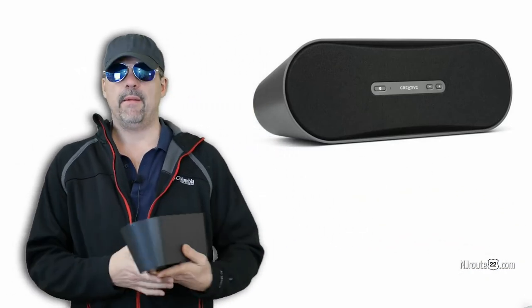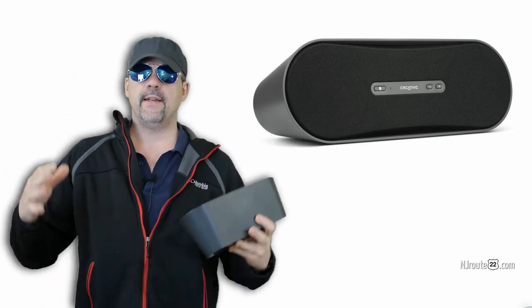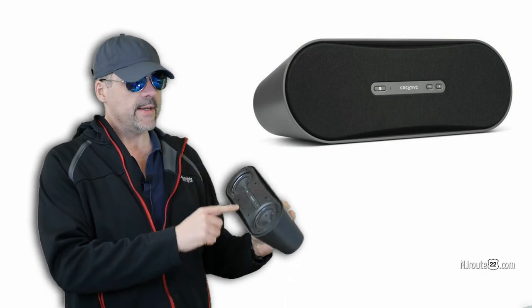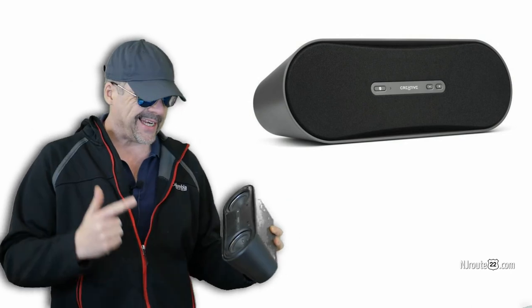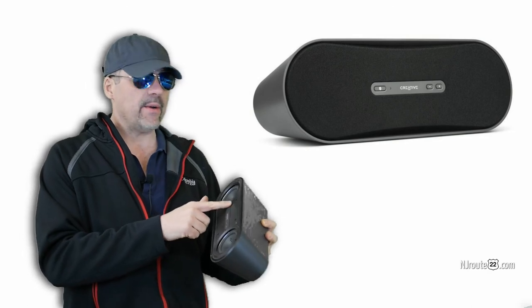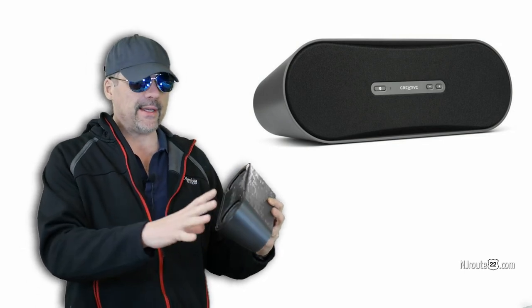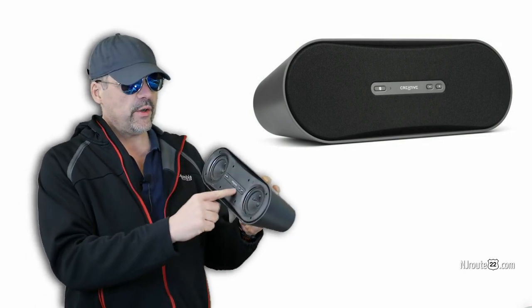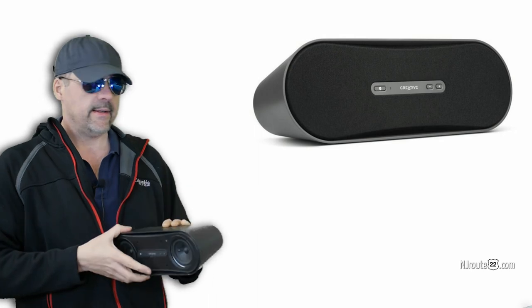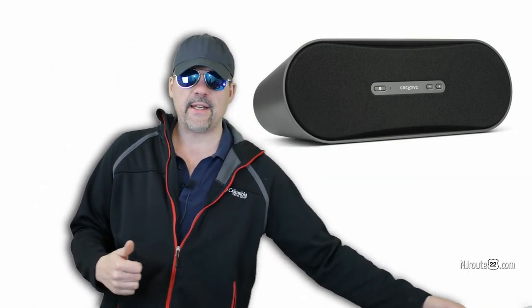In the end, I'm actually kind of mad at myself — but it's not the end of the world; the speaker still works. I wasn't mindful enough to realize how stupid it was of me to think they'd put screws underneath the fabric. So I ended up destroying the fabric because I just wasn't thinking. But if you wanted to keep it looking good, use a heat gun — shoot it towards the middle, it'll soften the glue, and just use a screwdriver to pry it out. Maybe you can learn from my mistake. Hit subscribe and like, and I'll see you next video.